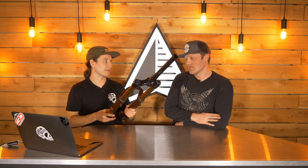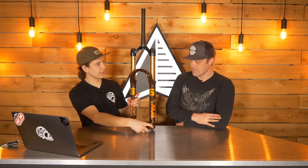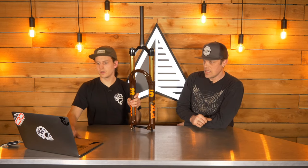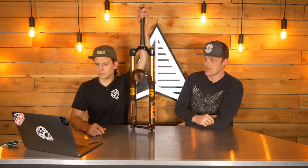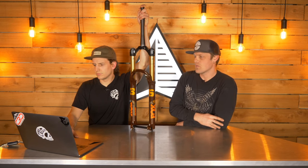34 to 38 is a big step up. That's a big jump. So 34 to a 36 is a noticeable difference. We get that question emailed to us a lot with customers that have a 140 or 130 travel bike. They're either looking to bump their travel up to 150 or stay at 140, and they just want a stiffer fork. And they ask if it's going to be noticeable. 34 to a 36 is a noticeable difference on the trail, and it's not one of those gimmicky things trying to sell you on stuff. It's a huge jump. Especially when you're riding rocky, rough, fast stuff, you can feel the 34 getting noodly in that 140, 150 range. The heavier you are or the more aggressive you are, the more benefit you'll have from a stiffer fork, and maybe not notice the weight as much.